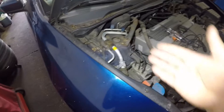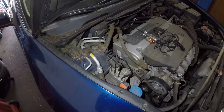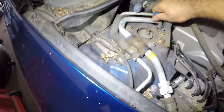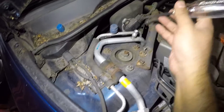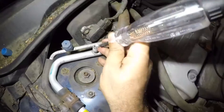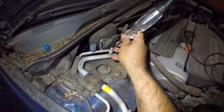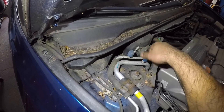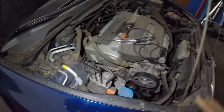If your line is hot, check the Freon. Maybe it doesn't have Freon in the system — it probably just has air pressure in it, which lets the AC compressor engage. To determine if you have pressure, open this cap and push on that little valve. You should see Freon coming out — it's a white color of gas. You only see it when it leaks, when you open that valve. If nothing leaks out, you will not see it.